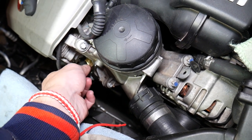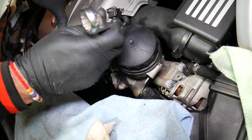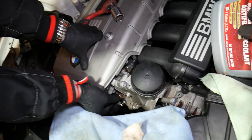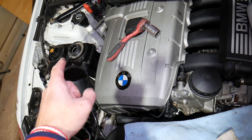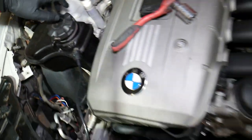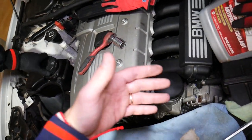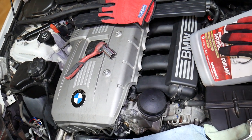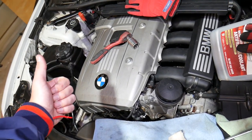Get it tight — not too tight, but not loose enough to leak. Install the wire. Then make sure you have enough coolant in your radiator and that your coolant tank is full. Step two: you have to bleed the cooling system. There is a special procedure to follow, otherwise you can have an air pocket in your cylinder head that can result in overheating your engine. Bleed the cooling system — hopefully this video was helpful. Thank you for watching, please subscribe to the channel, and see you next time.